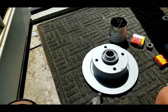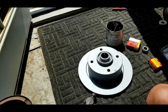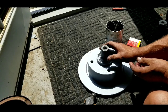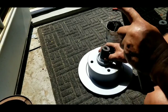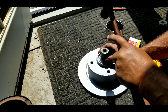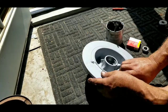I'm just banging it to level. The socket's going to sit right on top of that and we're going to drive it in until we hear like a bell ring sound. That's the sound you want to hear — that means it's bottomed out. And the other side, same thing.